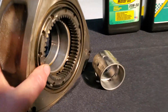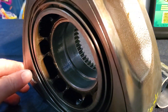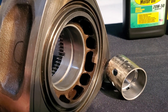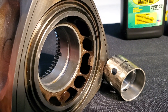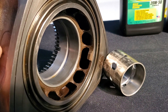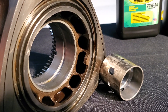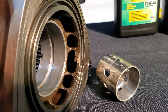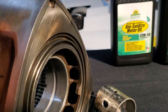This bearing is a competition Mazda bearing and it's got about two years on it — that's a lot of competition use: dynoing, missed shifts, going to 10,000 RPM. Obviously you have to have proper oil pressure, and in some of my previous tech talks I've talked about the dry sump system and plumbing we're using. But if you don't have a quality oil that provides the viscosity and protection under different thermal and pressure changes, you're going to have more bearing wear. A bearing failure can be one of the worst failures because it can take everything out in the motor.